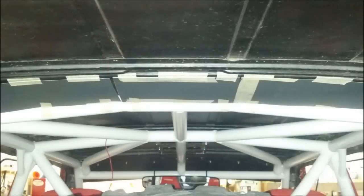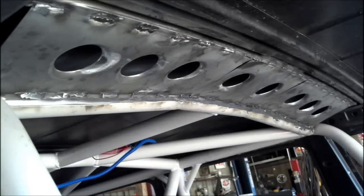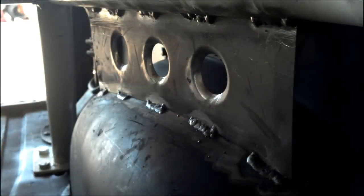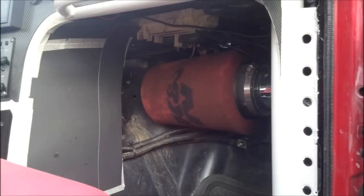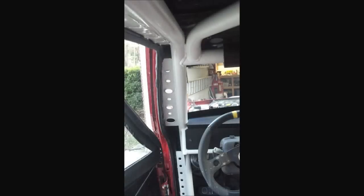The tie-in pieces are dimple-died so that they retain strength in the sheet metal. Here you can see the pieces going across the C-pillar — these are really big pieces, pretty hard to weld in place, but they'll prevent any movement. Over the wheel well I have them above and vertically. Along the floorboard and at the windshield they keep the cage moving with the body so everything stays rigid. Coming up is a great shot of three of those frame tie-ins together — it's really important.